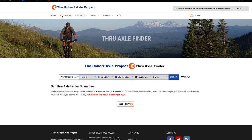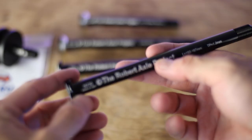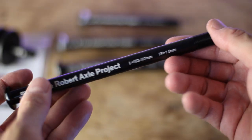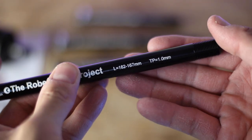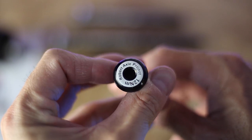As I started down what became a rabbit hole of through axle research, I happened upon the Robert Axle Project — a company that identified this gap in the market and went all in. I'll show you quickly how it works. It's really simple, as the guided search has you simply select your bike brand and specify any particular details. It spits out the exact axle specifications you need with a 100% guarantee on sizing to boot. The axles themselves are machined in-house from hard anodized 7075 aluminum, and they all feature a 6mm hex head, designed to be more robust than the 5mm hex head found on some models.